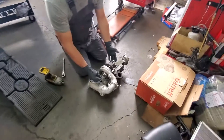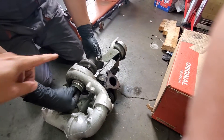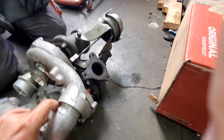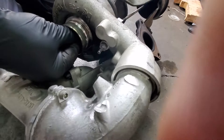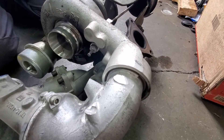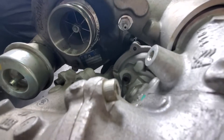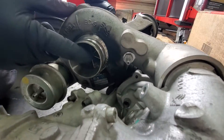Reason number one — here's the bad boy — the turbocharger. On the four-cylinder we have a special setup: one turbocharger on one side and a second one on the other side, so it's like a twin turbocharger. We took it out and realized the core is moving up and forward. On low RPMs this creates a strong whistle sound because the core of the turbocharger is loose — you can move it. It should not be like this.